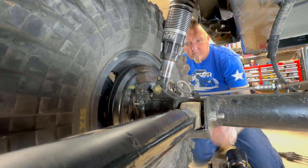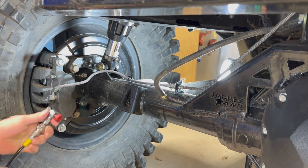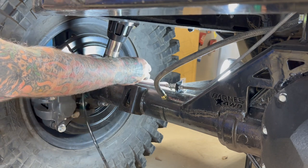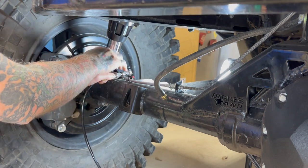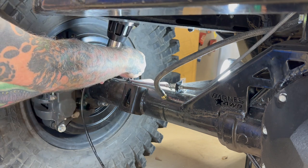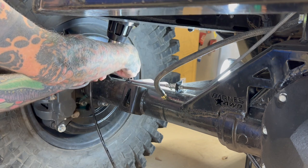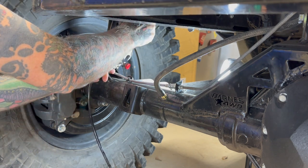Here's a different angle on the other side. First thing is to remove the cap on the Schrader valve. Now that we're looking at this, it looks like we might need some more in the upper chamber too, because now that these have settled there's a little less shaft showing than we want. Adjusting this lower chamber is not going to change how much shaft you have showing — that's all upper chamber stuff, that's ride height. So again, we're going to screw this fitting onto the Schrader valve, finger tight, then snug it with the wrench — just barely.